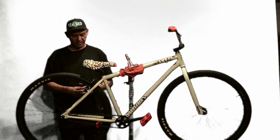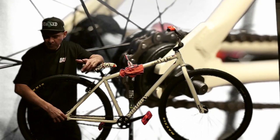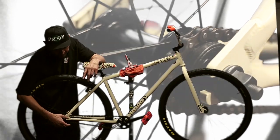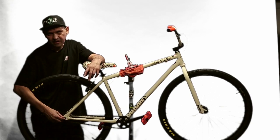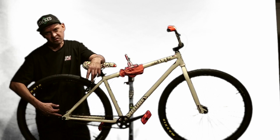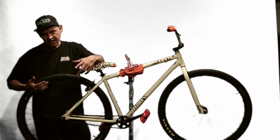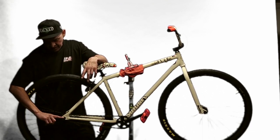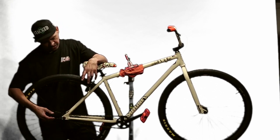I think it's perfect. Another thing that I noticed in the back is that there's a couple big bikes out there with a small sprocket, like a 25 or a 30, but some of the other bikes have like a 14mm axle. This one has a 3/8 axle, and this hub is also sealed. It's also got a 13-tooth freewheel on here instead of a cassette hub like the 14mm axle ones. But the axle has enough meat on it right here so that you can actually put a peg on there and won't have to worry about stripping out your axle.